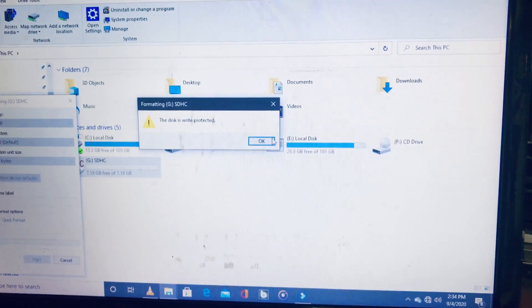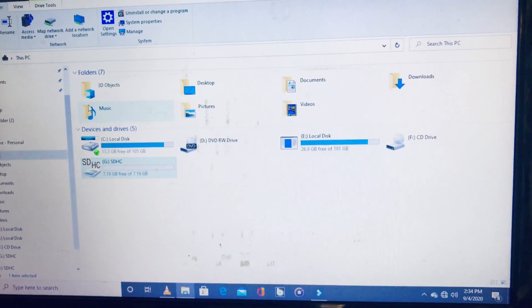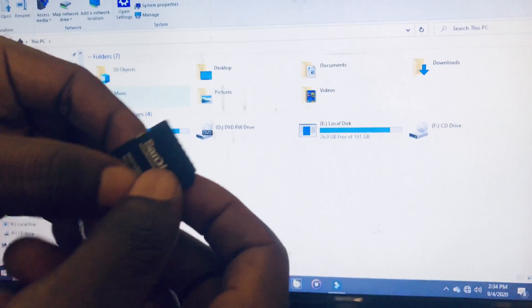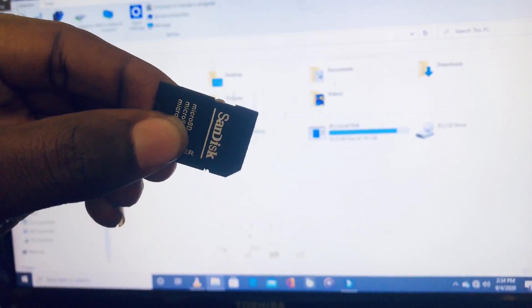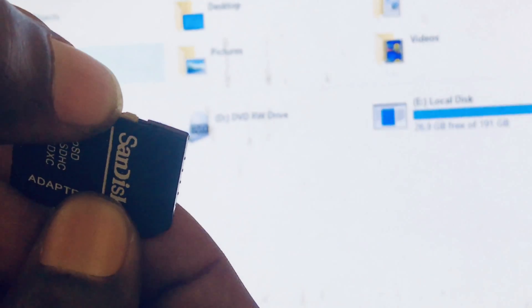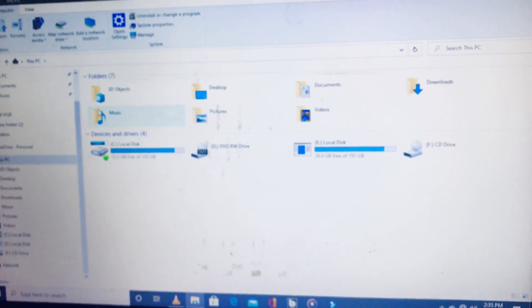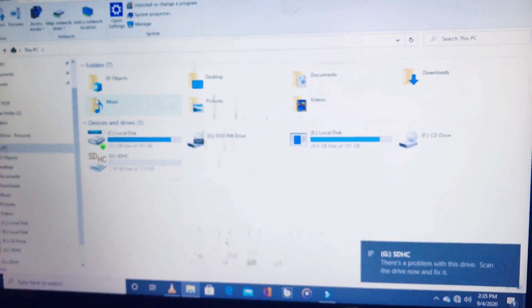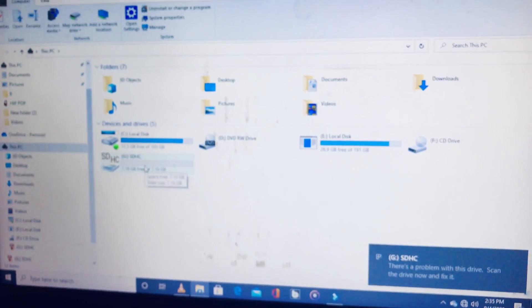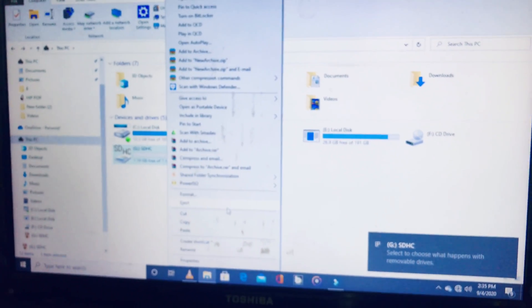So what you're going to do now is remove the SD card from your laptop and take it out. See this white thing over here on the side of the SD card? What you're going to do is pull it down — let it slide all the way down. Then put the SD card back into your laptop. Now let's paste whatever I copied and see if the write protection has been removed.